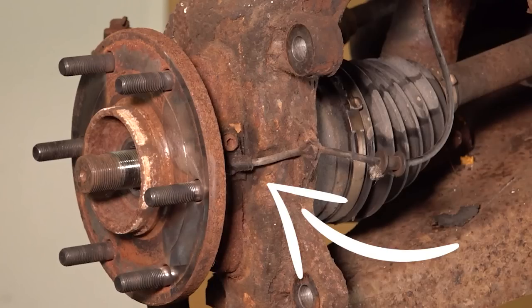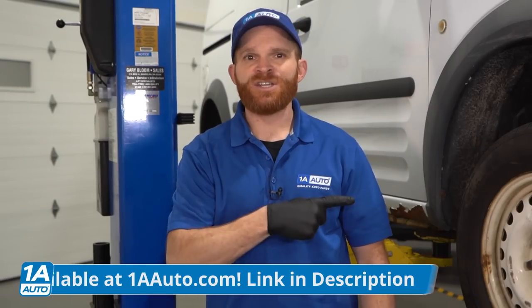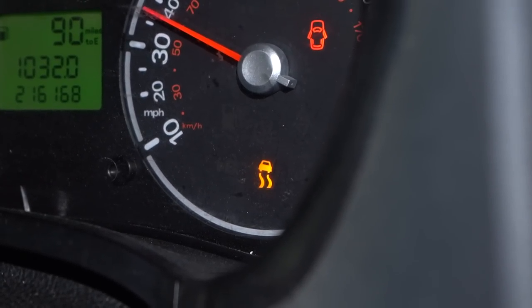You might happen to find that you have an issue with one of the tires wearing unevenly, typically on either one edge or the other edge. If that tire is sitting off-kilter because the wheel bearing lets it wobble around, it's tilting out a little bit while you're driving and it's going to wear out the inboard side of that tire. If it tilts in a little bit, same thing on the outside. You might also find that you have an ABS light. On your wheel bearing or someplace on the hub, most modern vehicles are going to have an ABS system that tracks exactly how fast each one of your wheels is spinning. If the wheel bearing is moving around, the sensor is probably not going to be getting a good reading, especially if it ends up damaging the sensor. When you have an ABS light along with an issue like this, you might also have a traction control light come on. If you have both of these lights, you more than likely have an issue with one of your wheel bearings.